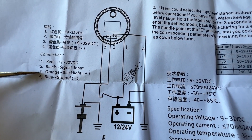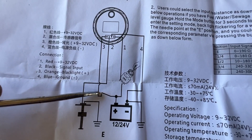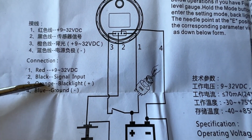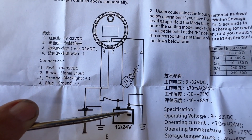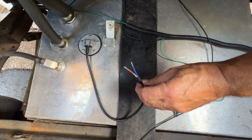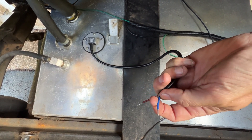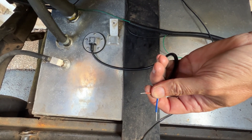Number three is orange, which is going to go to the switch on your lights and then to positive, so the backlight only comes on with the lights — that makes sense. And blue is ground, coming from the gauge to the battery negative — which is fine, except the sender unit wiring is blue and brown. Unless they think that's orange, the blue is not the signal wire — the blue is the ground — and presumably the brown is the signal wire. That makes sense, not.